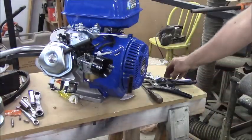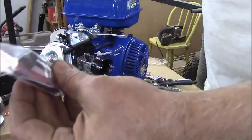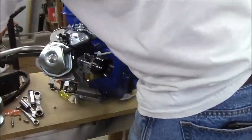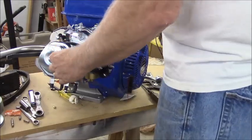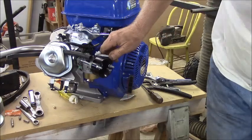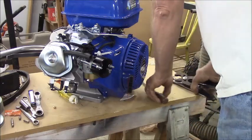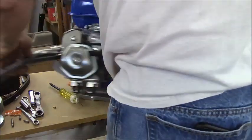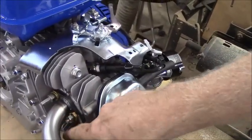I'm thinking we need to try to do a test start on this — what do you guys think? This is my vent kit. One goes right on here for the tank, and the other red shim goes inside of this tube, which will point it down out of the way here. Shove it in there and it will be over here out of the way. We don't need to do anything with it right now for a test fire. The fuel line is on and off. Choke on, choke off. I'm going to have to bolt this down to try to hold it in place because I don't want it taken off on me. It's going to be louder than hell because I didn't get the muffler on — I got the header pipe.